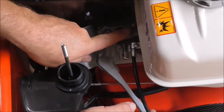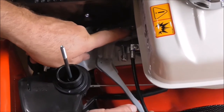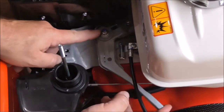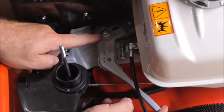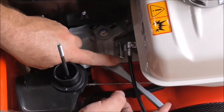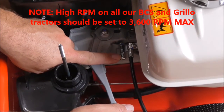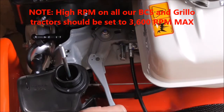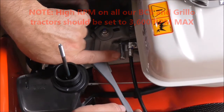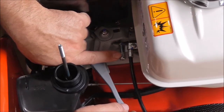Some engines have an Allen-type set screw to hold it in place. If this thing gets too tight, this piece right here doesn't want to move easily — you can loosen this up; I think that's a 10-millimeter just from looking at it. There's a stop screw right here that controls the high RPM. You can screw it in and out as necessary. If you're finding your RPMs up at 3800 and you want to adjust that, you can screw this screw inward and that will bring the high RPM down.